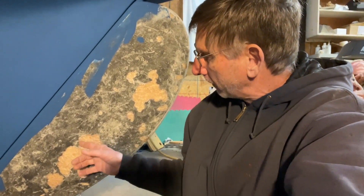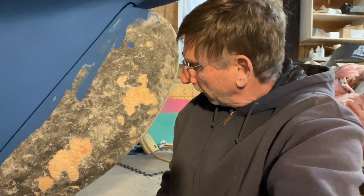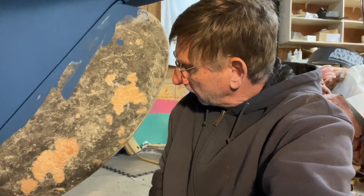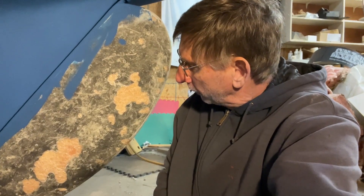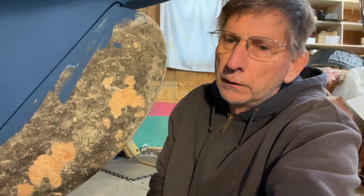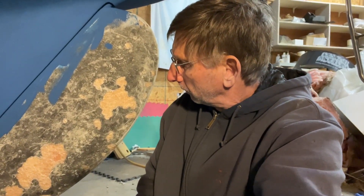I've got to scrape all the loose material off and grind it down. Then I'm going to make sure there's no wax on it — I think probably what happened was it didn't get de-waxed. I'm going to sand it down, de-wax it, clean it up good, and then fair whatever I need to do. Then I'm going to coat it with a layer of epoxy and then a couple layers of epoxy barrier coat, and then bottom paint.